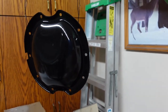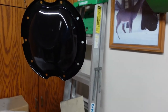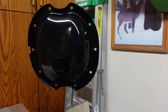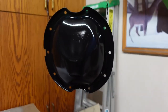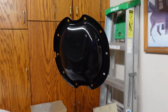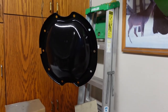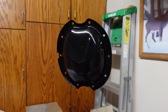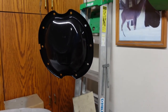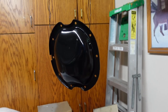Little by little, I'm cleaning stuff up. That's my rear differential cover and boy, she cleaned up really nice. There were a couple small little bends right down in here that I was able to pound out and kind of form out on the anvil on the vise. Then sanded it all down — used a wire brush and sandpaper, then flat sanded the back side on the workbench. That cover is not warped at all, so the gasket should seal really good. It took me a while to get all the old gasket off of there. Differential cover came out really nice.